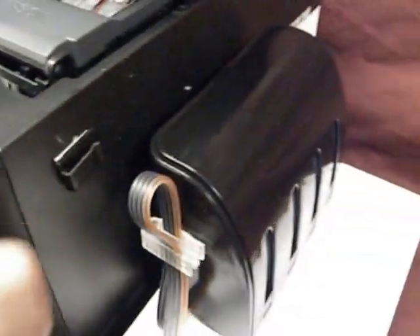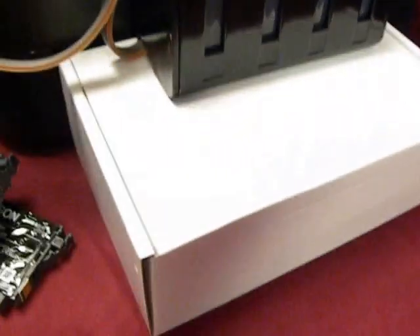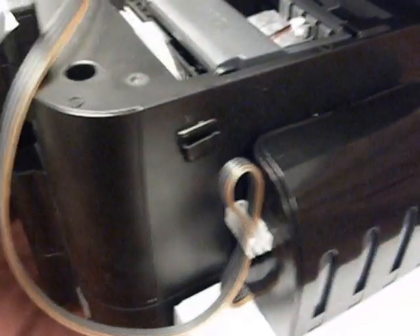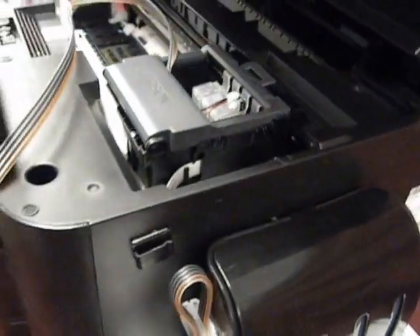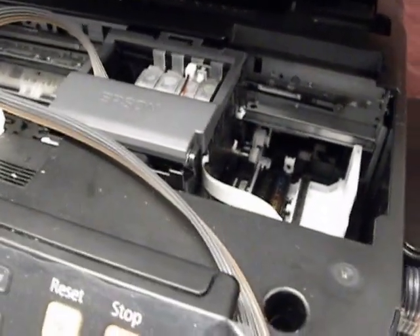We didn't have to cut anything in the printer or take anything off — it's very simple to install. Use the interlock plug, hose brackets, make sure you lift the box up. The CIS can go even with the top of the printer or a little bit lower, but it cannot go on the table because of the added tray. Even if it didn't have an added tray, you want to make sure it's just below the top of the printer when the scanner is open. If you see a little bit of air in the hose, that will go away once you do a printhead cleaning.